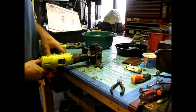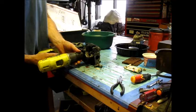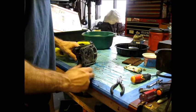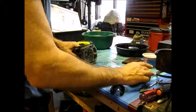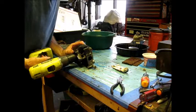That should do it. He was like 'wow' and I was like 'we could do this — that's how I do it, it goes fast that way.' So we're going to do this one now, just grabbing the end carefully. I like these chucks because they don't grab too hard. Let's take a little bit more compound — plenty of compound. You don't want to get it into the valve guide, so try to avoid that.